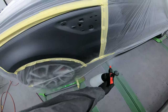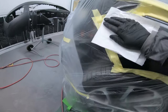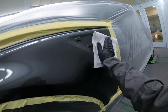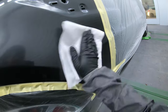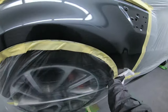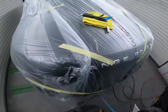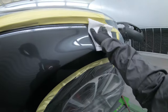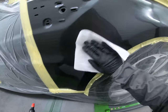Here we go then. A little backstory on this one. It came in for a headlight repair and a new front bumper. We painted it — I didn't really film it because there wasn't much to look at, it was just a factory primered front bumper. Quick bit of colour, put it back on the car, no problems. But then we put it on the car and noticed it's too dark for us to think it was acceptable. So we've got the car in the booth, prepped the wings, re-prepped the front bumper, and now we're ready to blend into the wings with the same colour to ensure a good match.